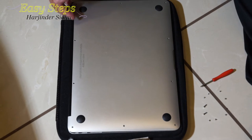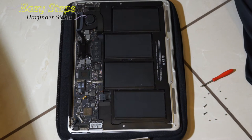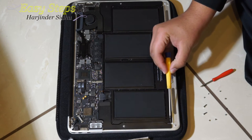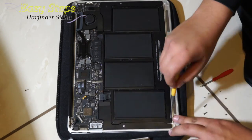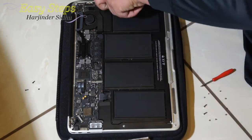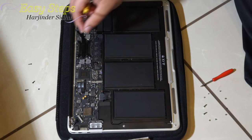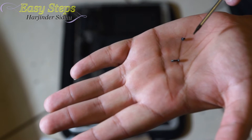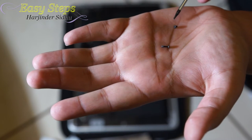All you have to do is put your finger right here and lift up slowly and put this to the side. There are five screws that we're going to be opening — the last one being the fifth. Please remember when you put them back: the top ones are the long ones and the bottom ones are the small ones.